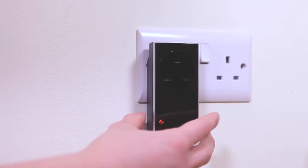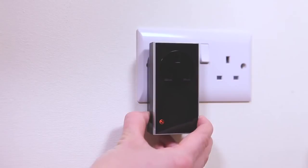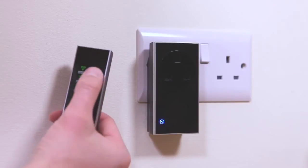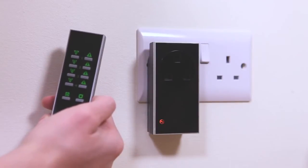Press and hold down the manual button until the LED flashes blue and amber alternately. The plug-in is now in linking mode. On the handheld remote or other control device, press the button intended to be linked and the LED will flash blue to confirm that the remote is now linked.